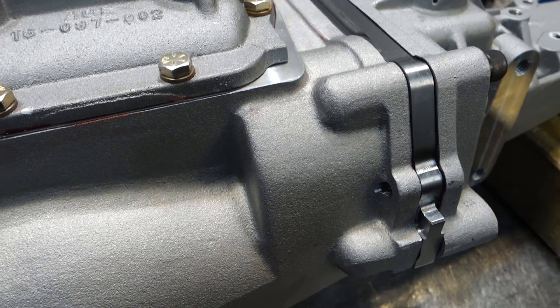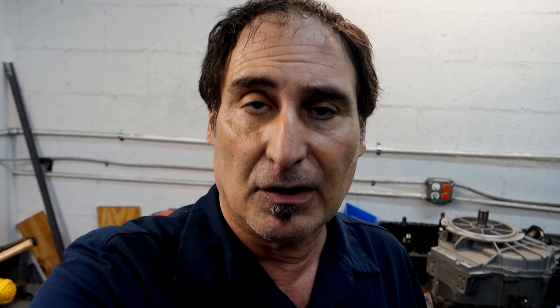The steel plate is made out of a chunk of solid steel that's flame cut to close to the same profile and cleaned up on a milling machine. All the machine work is done on a high-speed Haas vertical CNC milling machine with a Renishaw probe that comes down between each operation to do all the QC and checking before going to the next step. This saves a lot of waste - if something is off, you don't kill the whole run with bad defective parts. Probes are very expensive and a lot of people don't do that, but this way you're not ruining the whole run if something drifts off. That's how these plates are made and why they're so accurate. The mid-plate is an extremely critical part in maintaining the accuracy and performance of a Muncie 4-speed in high performance and even regular use. Long life of your bearings, pilot bushing, crankshaft, driveshaft yoke, and driveshaft bushing all depend on that alignment. Thanks for watching - please subscribe to my channel and leave me some comments.